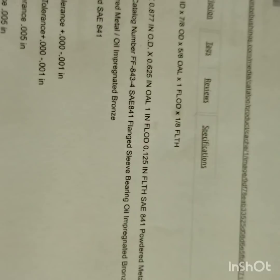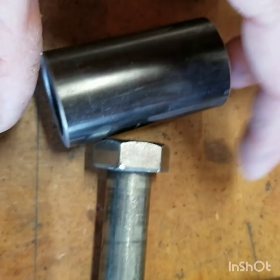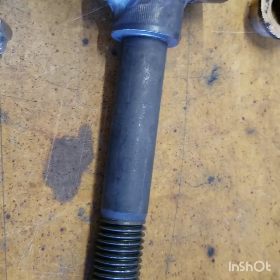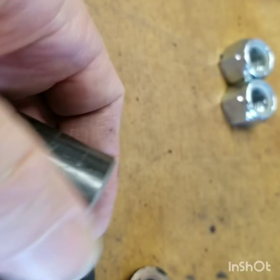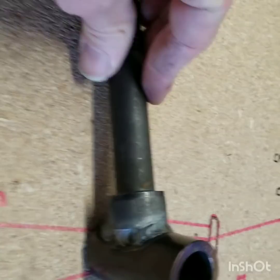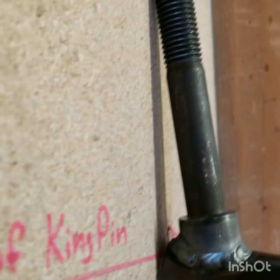So those are the nuts and bolts of it. I've already had my parts welded — the cap screws. First step was to take the cap screw; we're using a cap screw because you can get a better weld on it as opposed to a regular bolt. Roy Fields at Fields Fabrication welded these for me because TIG welding is not one of my skills. What he did is he put this on a mill and convexed the back of the bolt to where it matches up — looks pretty good, should be plenty strong. He also did a little machine work, chamfering the edges a little bit. A couple hours of labor and he knocked those out. I put them on my table — this is perfectly parallel to the ground, 14 degrees offset. You can see how much offset there is when I set it straight.